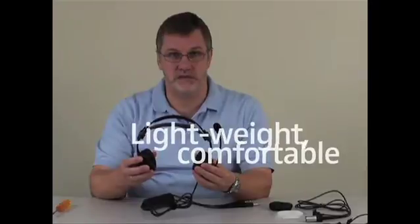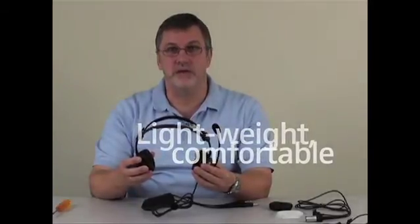fix the screws. You know, from bigger headsets, let's say circumaural headsets, they have contact pressures up to 10 Newton. And this one has just 3.6 Newton. So you can imagine it has a big influence on the pressure you feel.